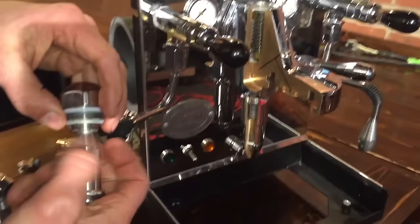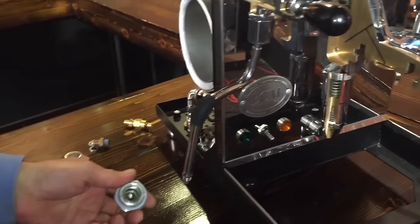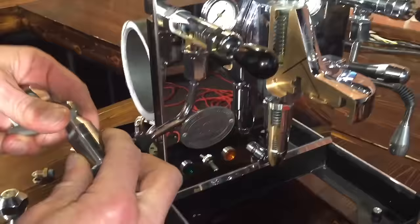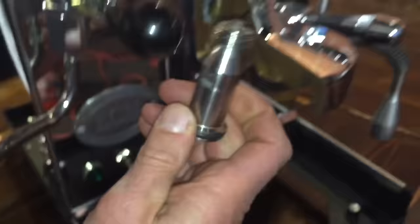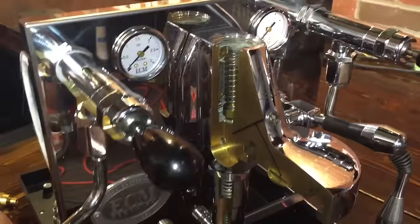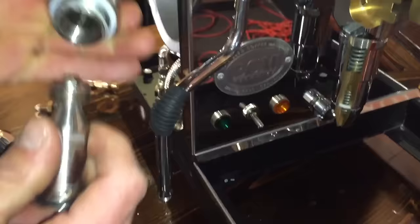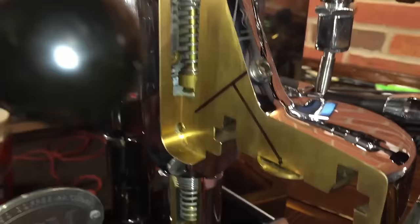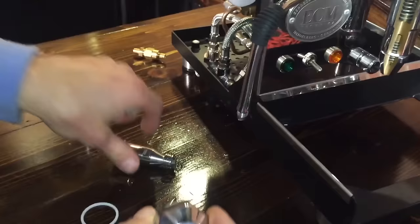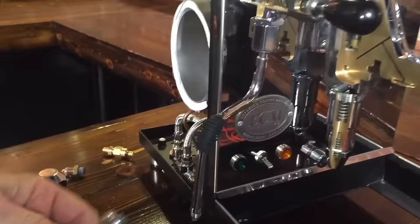There's a screen in there. This piece is down on top of here. These little holes — it's that tiny little orifice where all your brew water is going through. Through these four holes, then through this one here. So if you raise the lever and the pump goes but no water is coming through, that orifice may be plugged — you know, if you get some minerals or calcium, some gunk somewhere.